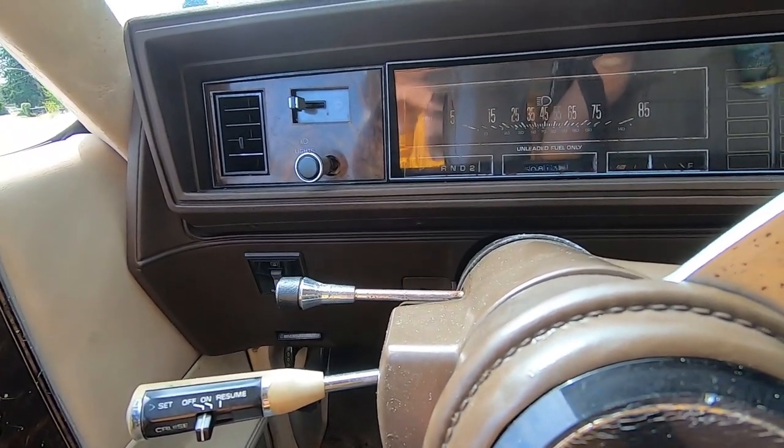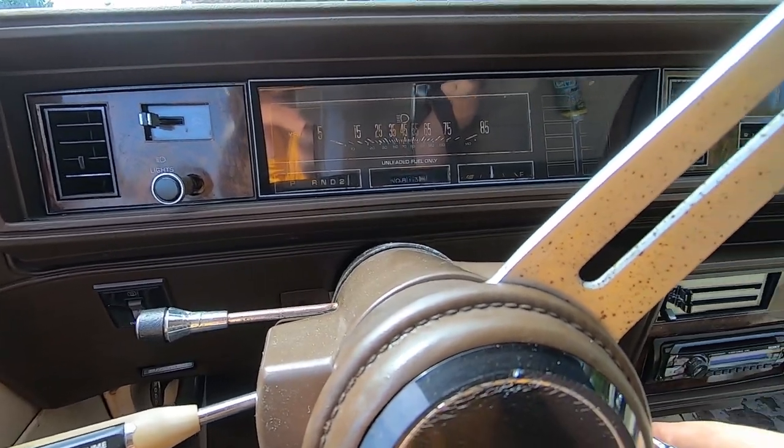Maybe the torque converter is just not having it. See if you'll even do first. It sounded like squirting of some sort. I bet the tranny has zero fluid in it. Probably should have checked that prior to trying to drive it. This could be really awesome or really disappointing. Okay, put 2 quarts of tranny fluid in it. But in order to check it, I just kinda wanna drive around the block, make sure everything's all lubricated and the fluid's moved around before I actually put the right amount in.